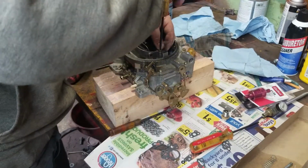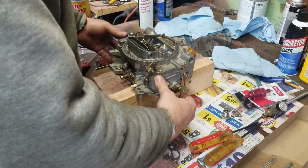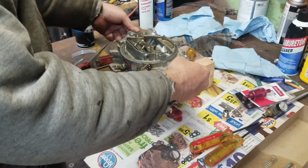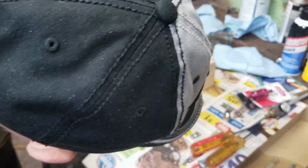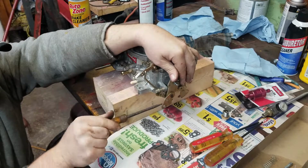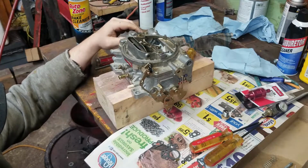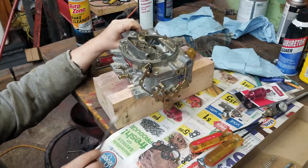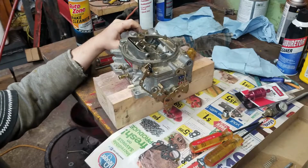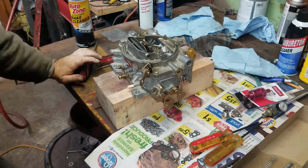We still got some. But you know how I got those clear fuel line filters? He goes, yeah. Mine didn't work, so crap got right in the carburetor and plugged it up, and it was just dripping gas onto the intake. Oh my god! Lucky for Aaron and Michael, kind of to the rescue. I was freaking out, dude, because the truck wasn't done yet. I'm still in the process of rebuilding the carburetor and waiting on the rebuild kit. Once I got that in, but I was in no hurry. I just didn't feel like doing it anyway. Now it's all done.